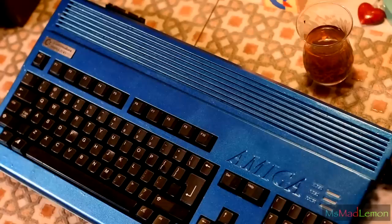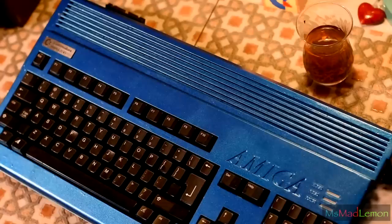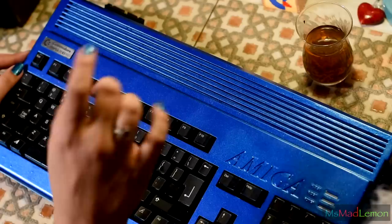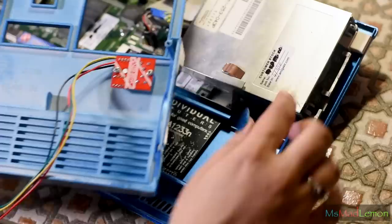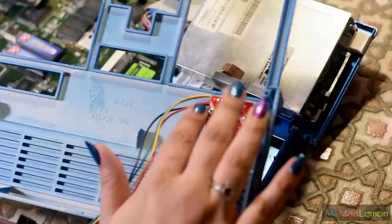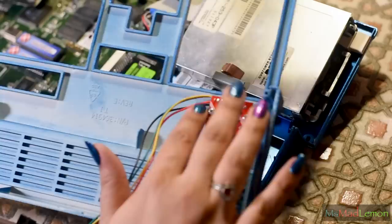Anyway, let's continue with the Bifrost. Here is my beautiful metallic blue A1200 — I've linked the paintwork series and upgrades in the description below. I've already unscrewed it. One thing to note when installing the Bifrost: it sits right near your floppy drive, and there's a chance the pins can be shorted out by the floppy drive itself. I'd highly recommend putting some duct tape or insulation padding over that area.